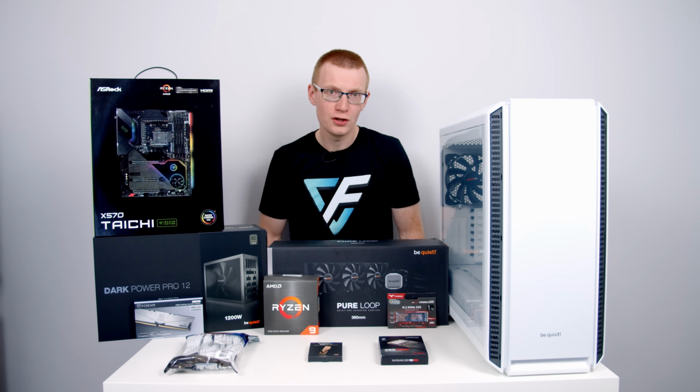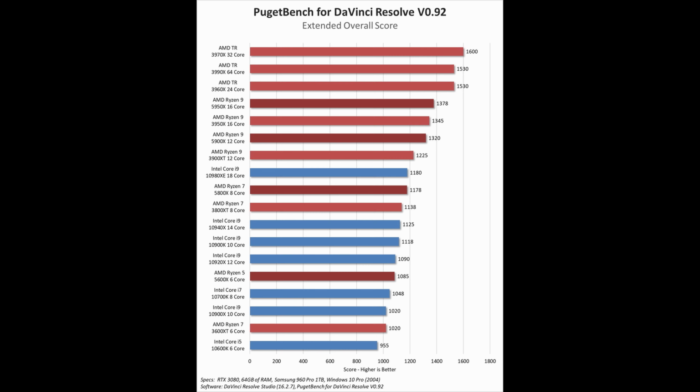So bringing things back to our CPU choice for our video editing PC, focusing on DaVinci Resolve, I think the best place to go to look at the benchmarks is Puget Systems. When I was building my first video editing PC, this is where I explored things and helped me decide on what components to go with. Looking at their benchmarks, we can see it's mostly AMD CPUs at the top of the list, with the high core count Threadripper CPUs performing the best. The new Ryzen 5000 series CPUs perform particularly well, particularly the Ryzen 9, 12 and 16 core CPUs.